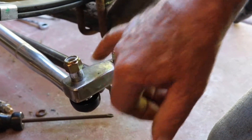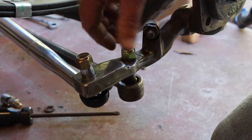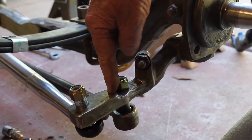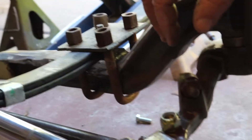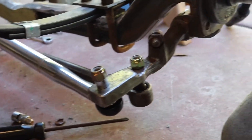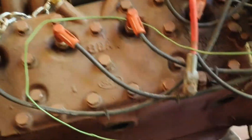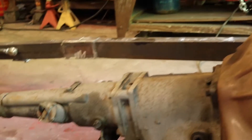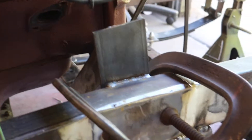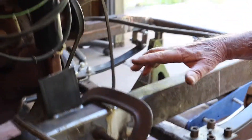But over here on the other end, I was trying to figure out how am I going to get this half inch stuff to work. So I used a little bit of engineering — half inch bolt and that's a five-eighths inch hole there. Well, I took a seven-sixteenths inch three-eighths drive socket, drilled it out, drove it down in there, and I'm going to cut this off — what it made was a shim, and now the hole in here is half inch. See how tight it fits? Oh, that's beautiful. It fits perfect.